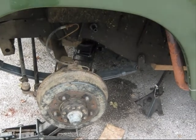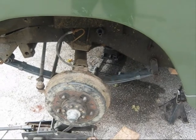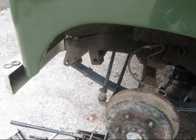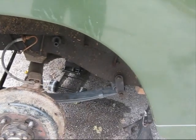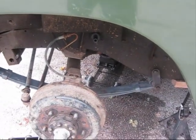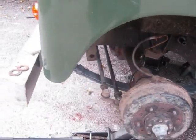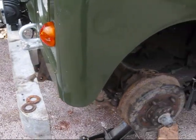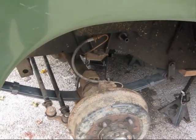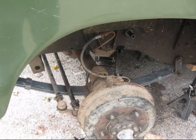It could be easier — I suppose I could disconnect the prop shaft, but I'm just trying to avoid as much as I can. That's not too far out. At least I can pull that forward off the spring shackle, even if I get a little ratchet strap and pull it forward, then just put a bar in there to hold it down. I'm sure I'll get around that a lot easier than trying to locate that pin — I've huffed and puffed and I couldn't get it on. No way, not in this earth.